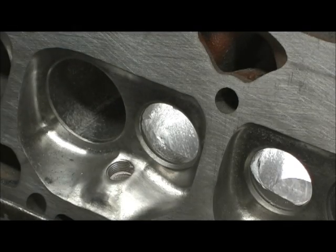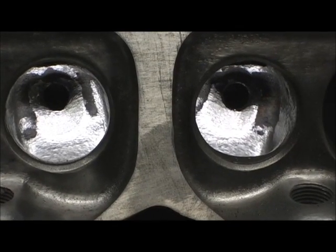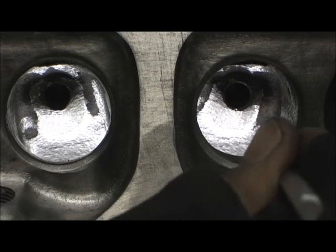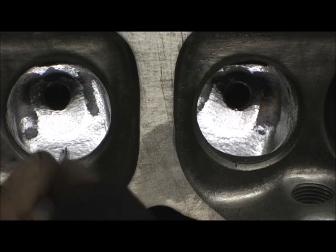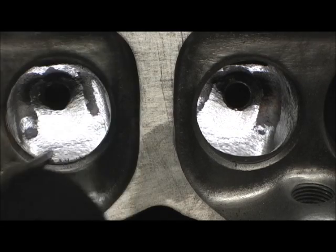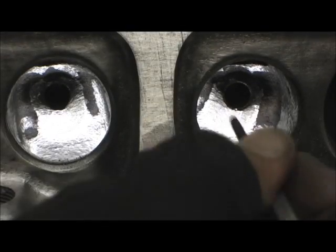I'll switch to the smaller egg and pull it in and take that ridge out, because when you stand straight down at it, you don't want the fillet to be protruding outward. Now look at the difference here. You can see the dark shadow of the one on the right, which I haven't ground on yet. That's the fillet. Notice how this one — past the 60-degree angle — there's nothing in its way. This is what you're looking for. It's going to come right off the seat, off that 60, and roll right into the exhaust port.